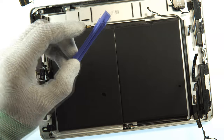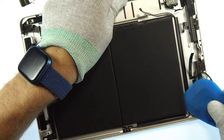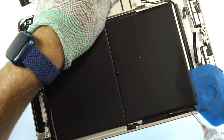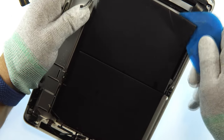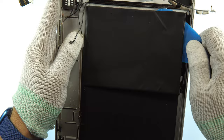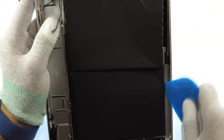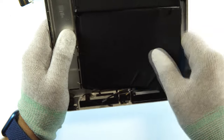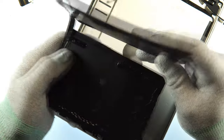To remove the battery, heat it up again and use more isopropanol so the glue loses its hold. Use a plastic pry chip and go underneath, adding more isopropanol as you go. The iPad battery is very strongly glued to the frame, so take your time — don't bend the battery too much. I have the first cell loose now, doing the second one. Be careful with the flex cables. Now pull out the second cell, remove the whole battery, flip it over, and it goes in the bin to be recycled.